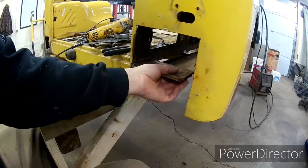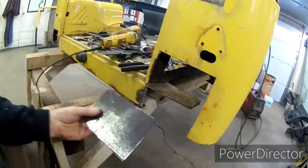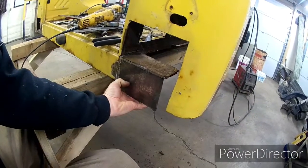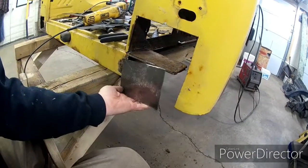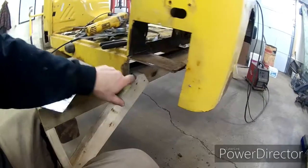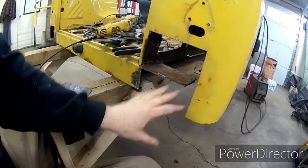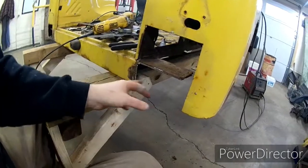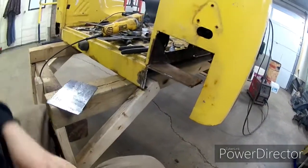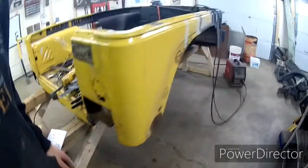This piece here is still quite solid - the top section is quite heavy. What we're going to do is make a patch that's going to fit in right here. It's going to get welded, and the bottom edge is going to get broke over so it matches the lip on the bottom - that gives us some structural integrity. Then I'll make an entire patch that will fill in this whole area, plug welded in several locations along here to bring it back to its proper position and give it strength. That's the next step.